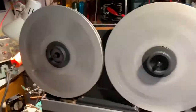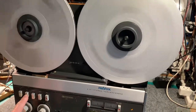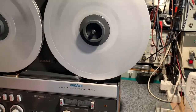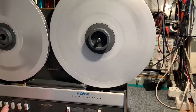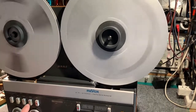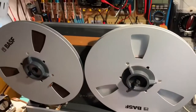The brakes are pretty good on this unit, but the recommended technique is that when you see the tape counter is almost at zero, you click fast-forward momentarily. That does the braking action electronically — electrically — rather than using the mechanical brake. I'm clicking right now, and then stop. That's the preferred technique, and it certainly saves wear and tear on the brake drums.